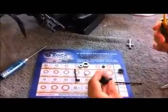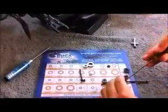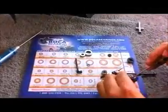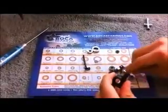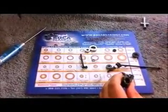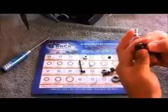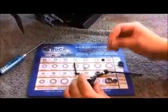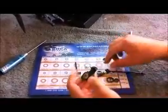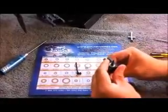And we're going to take our flathead screwdriver again and remove the stock bearings. Here's the first one. The second one's a little bit harder to get out. I'm going to actually just pry. There it is. That's what the stock bearings look like. Then we're going to replace these with a high quality ceramic hybrid bearing from Boca Bearings again. Snap that one in. As we hear it snap, we're going to take our other stainless steel bearing, insert it, take our CVD, put it back into our hub. Make sure you have nice free motion again.